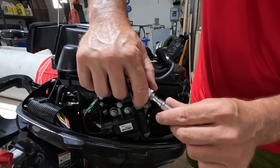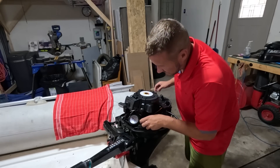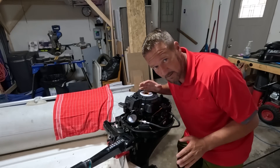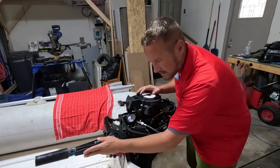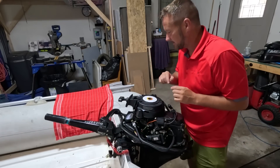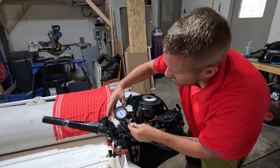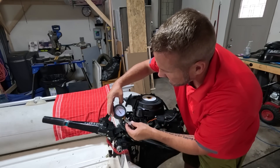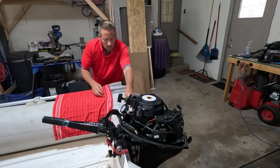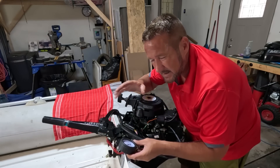We connect the gauge — it's zeroed. Now that the gauge is installed, we set it somewhere visible but out of the way and give the engine six to eight rotations as Philip suggests. It's a pull start rather than electric, so it's a bit more work, but we pull six to eight revolutions keeping an eye on the gauge. The peak on this gauge is about 158 to 160 psi. Moving to the other cylinder, we're getting about 150 psi — about 8 psi lower, well within a 10% variance.